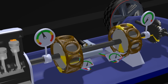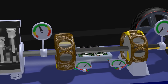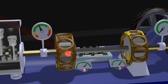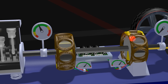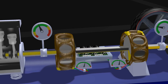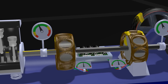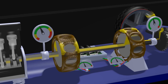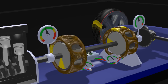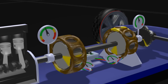Let's take a closer look at what's going on when we pull up with this car. At first, all energy is absorbed by the generator, then pushed back in by the electric motor. But while we're speeding up, less and less energy takes the electric path, while more and more is put through mechanically through the axle. When both axles have the same speed, generation stops. But now the generator acts as if it's locked, so the petrol engine connects directly to the wheels — super efficient.